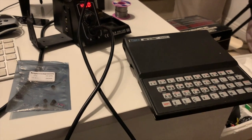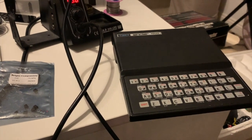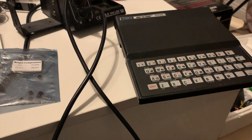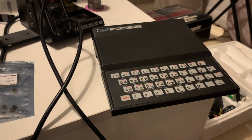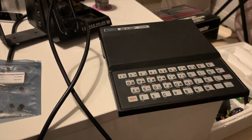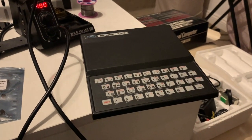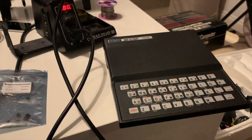How does this work? Well, the good old Sinclair — or Timex Sinclair — does actually create a composite signal already. The ULA does this, but it is downgraded and converted to RF rather. And that's the connection that generates the signal. That works on old-fashioned TVs where you twiddle the dial and the snowy picture will eventually become the picture of your computer screen.